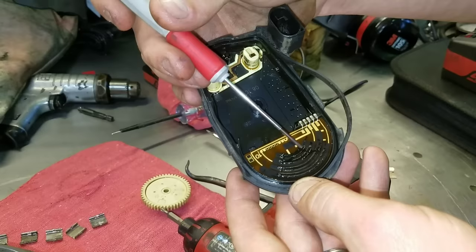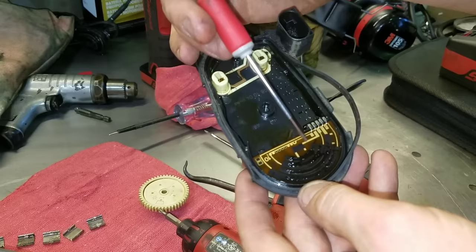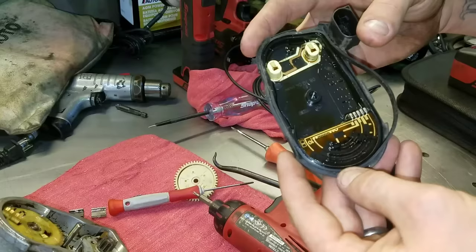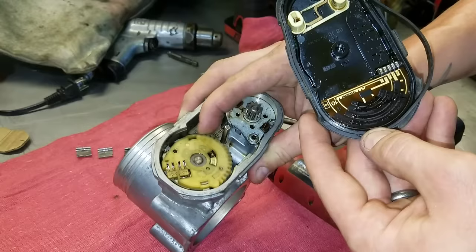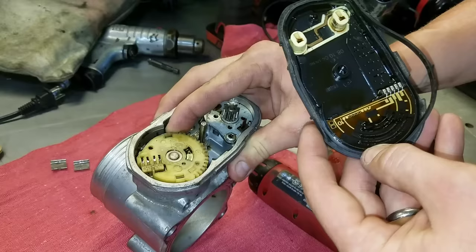You have two sweeps here — one set here, one set there. It might be the other way around: this one feeds that one, that one feeds this one — but they're always in pairs. They use double redundancy to make sure that if there's an issue with one of them, it checks and double-checks it with the other, because electronic throttle has no cable — it's important that things are working properly. The contacts rub against the potentiometer as it opens and closes. The computer commands it open to a certain spot, it goes there, gets read, and then the computer confirms it's where it's supposed to be.